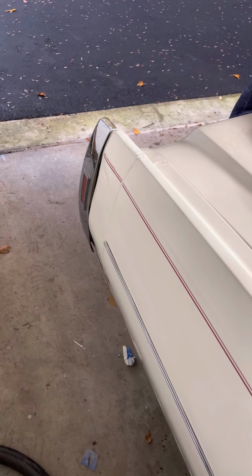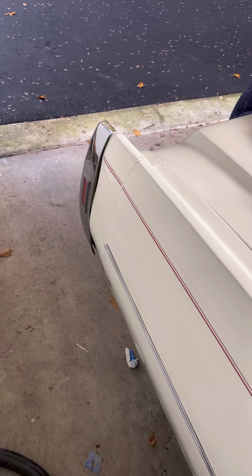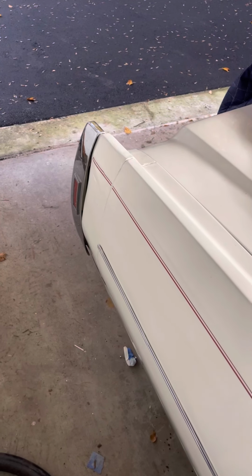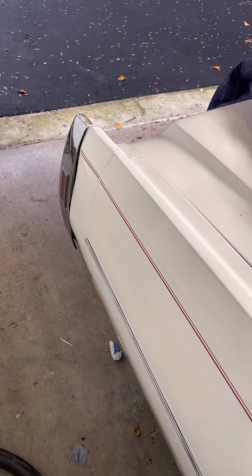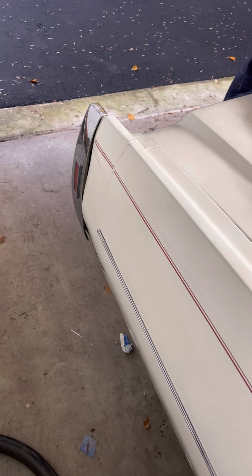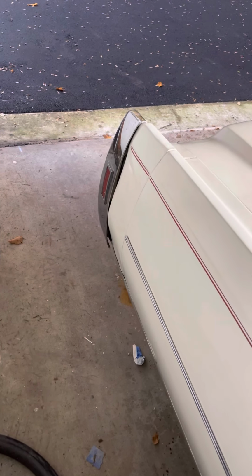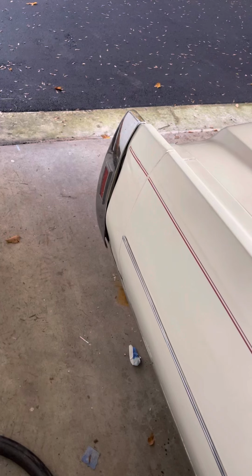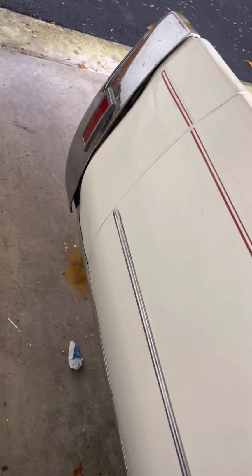finishing putty for Bondo, skimmed it multiple times to build up a layer on top of the cracks, and then sanded it as best I could, sprayed it, and I had to re-pinstripe it again a little bit over here. But you see the bumper filler is still a little deformed from the pull, so the pinstripe is a little bit warped.